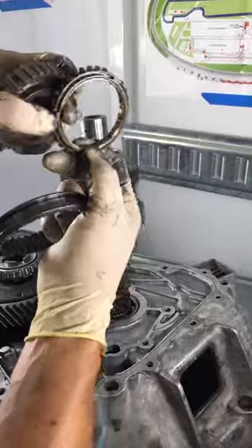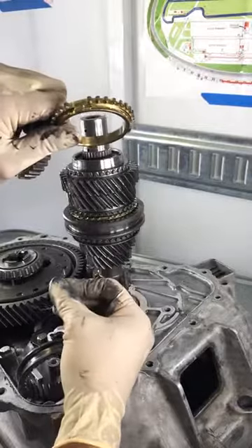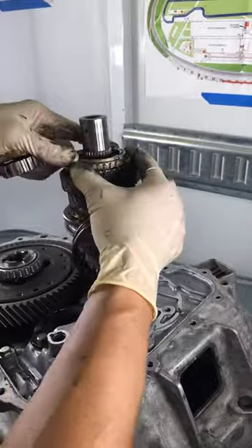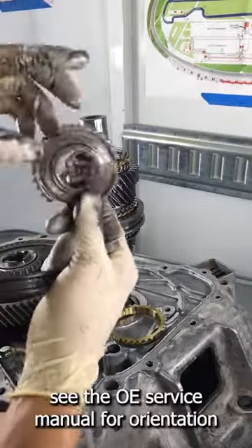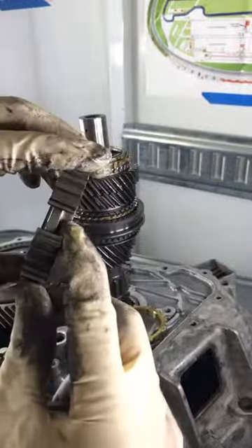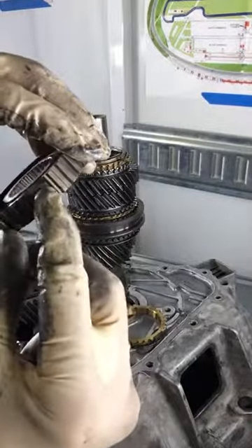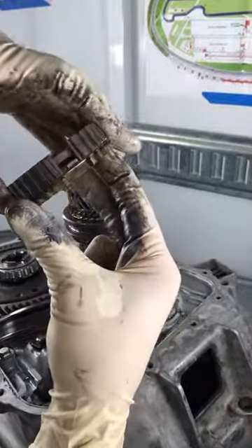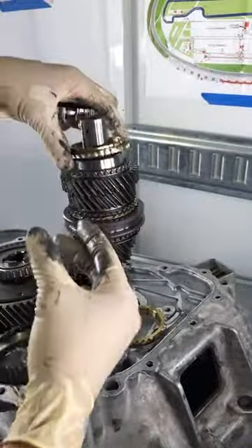So you just put this hub on here like this. This is the synchro ring, the synchro spring — put these two together, drop that right on here. And then the hub fits a particular way — the hub is different right here, and you can see that this section is deeper and also tapered. And there are also these holes in here, and this synchro ring fits in there. See the little protrusion that's right there? It goes right in there, and that's how we know it fits.